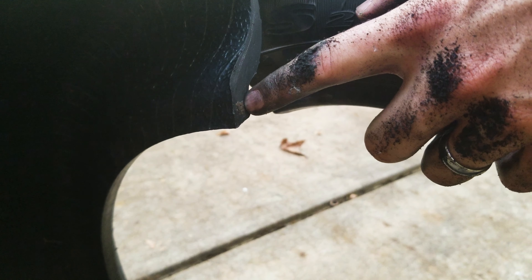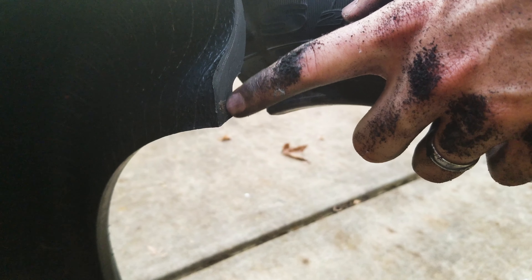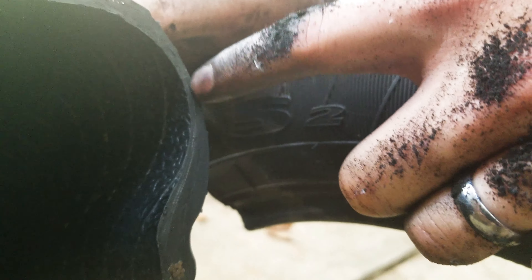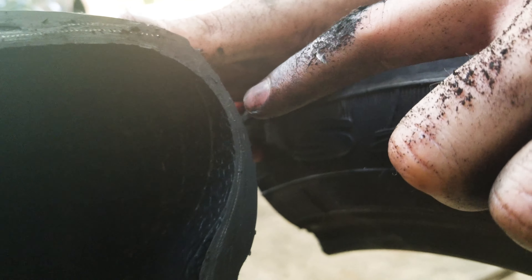What you've got here is the bundling of bead wire that I was telling you about. You can see that it's different strands. If you can see these tiny white dots, that's actually the polyester cording that goes up and comprises the sidewall's strength, because you can see how thin the rubber is actually on the sidewall right here.